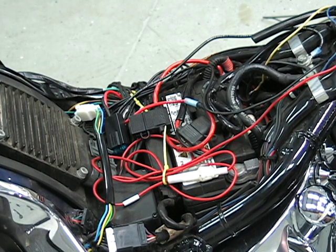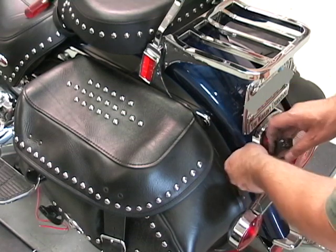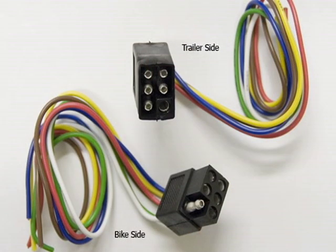I'll button this up and this bike will be ready to test. Can you see the wiring harness? Here it is — it's down by the bottom of the hitch. When the rider isn't towing, he can stow it here in the saddlebag where it will stay out of the weather. I want to touch on just one last point. If you're using a molded plug like this, make sure you use the plug with the exposed ground for your bike. All the potentially hot wires will be inside the plug where they can't make contact with the ground on your bike. The plug with the exposed pins and the shielded ground is the plug that will go on the trailer.